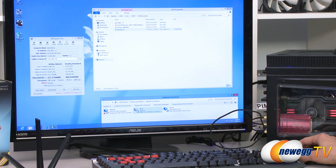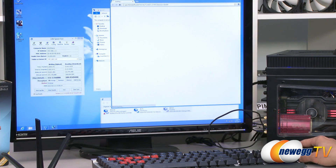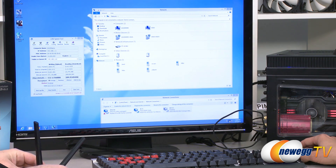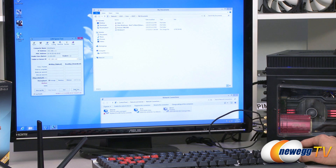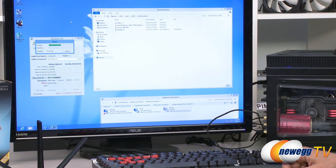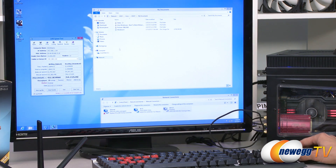Let's go ahead and take our final look at 802.11 AC. We'll enable that connection and disable the other one. We had an add-on USB 2.0 802.11 wireless N card plugged into our laptop demo machine — now we're switching back over to the 802.11 AC unit, which is currently installed and connected to the 5 gigahertz band using the AC card. Let's run the speed test. Here we can already see the huge increase from 802.11 AC — that's significantly more. On the writing we did 471, on the reading we did 389. In an ideal environment, what I've seen on this card is between 450 and 500 in a household, which is not unexpected. So we've gotten to look at some real world speeds.